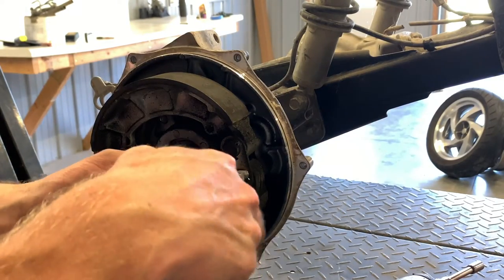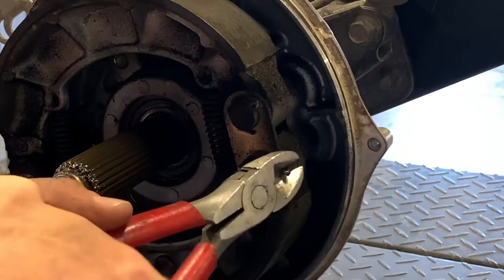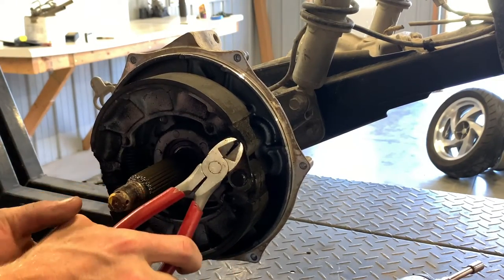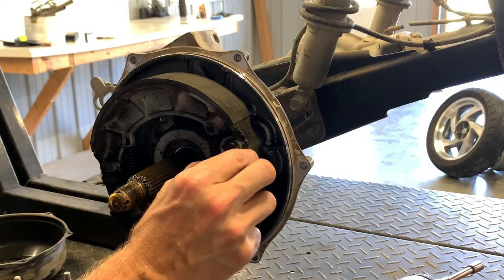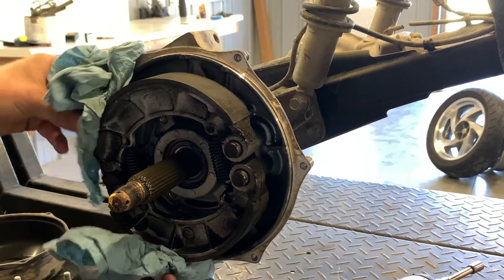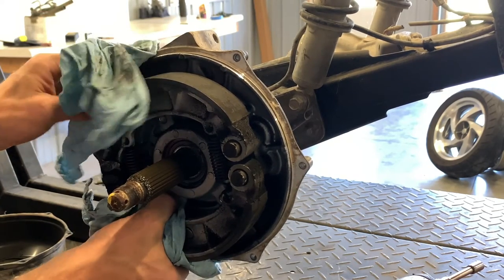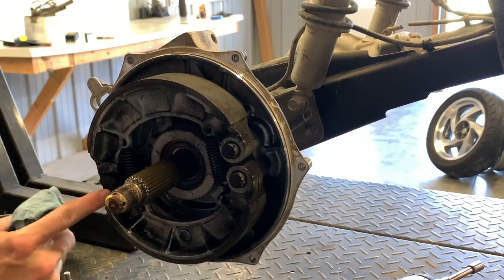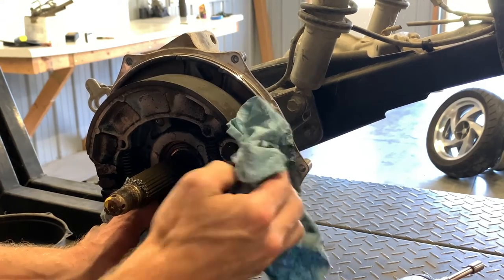To replace your shoes, take a pair of side dykes, get in behind here, and pull on this cotter pin — just straighten it out and pull it. Do the same thing on the other side. Now we've got a little plate holding this on. We can just take and slide our shoes off. You still have your springs on there and that can be fairly difficult. I'm using rags because this brake dust is nasty and dirty with a little bit of grease and oil in there. There's a little lip on this pivot point, so you can do one side at a time and pull it out.